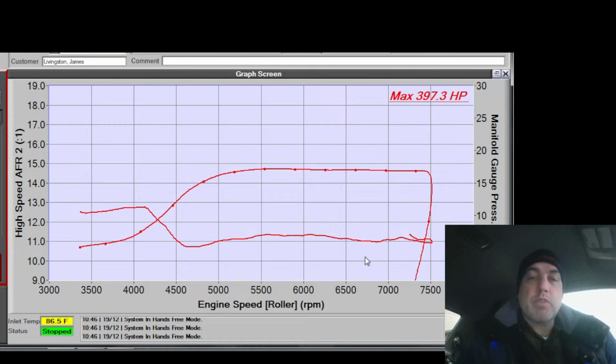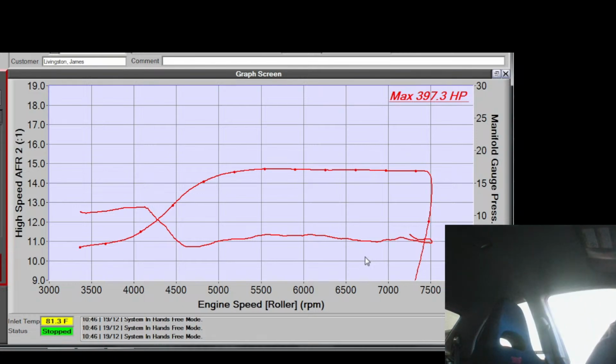Let's see, that's technically a post-cranking airflow reference then. Yeah, 2.2. So that's what's going on. That's why it's not flaring, because I'm stuck in a post-cranking mode. Okay, so I'm going to bump that up like this. And I'm going to save that. And then I'm going to flash this one before I do the next pull. I'm going to flash it because I want to see the idle air stuff. So let me do this. Of course it's not. This is a green connector car. Because God loves me. Key on. All right.